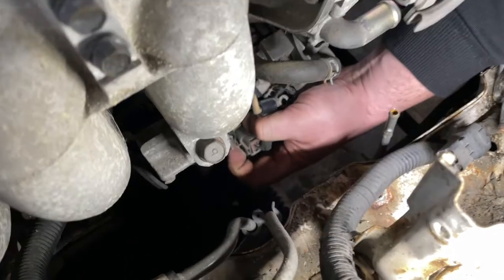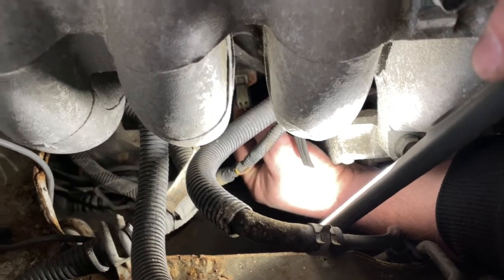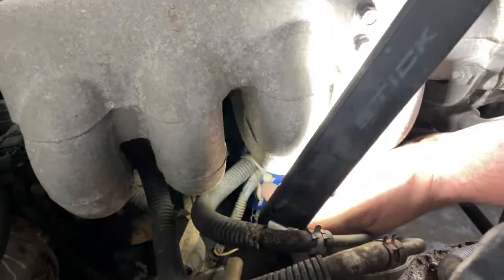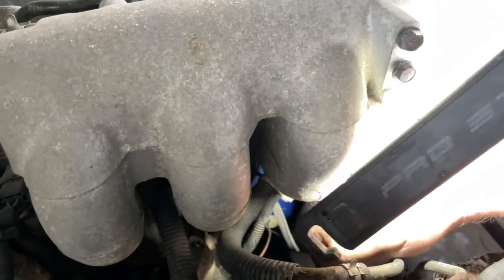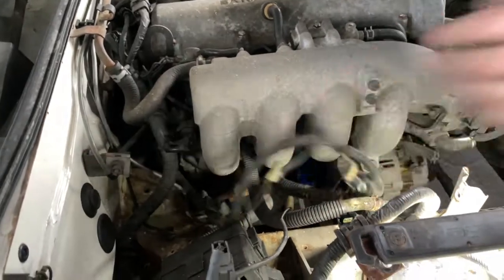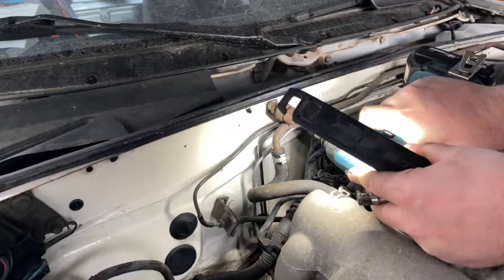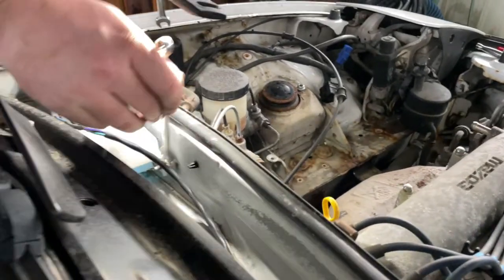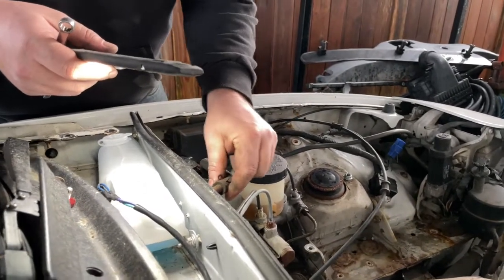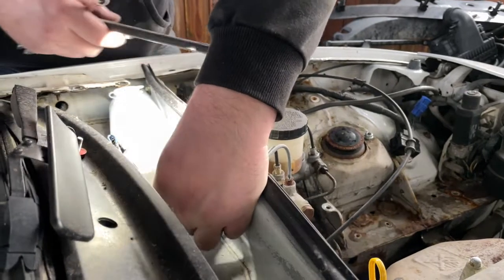Depress the tab on the electrical connector for the alternator and pull the connector right off. This is the engine oil pressure sensor — depress the tab and pull that connector off as well. This car used to have a block heater and the wiring was left in, so I'm just going to cut that zip tie and pull the wiring harness back through. Then I'll pull the vacuum line to the brake booster — there's a rubber line here that goes to a metal hard line. We installed a Cappuccino windshield washer bottle and used one of the bolt locations for the brake booster vacuum hose to mount the bottle, so I need to remove that nut to access the bolt from the engine bay side.